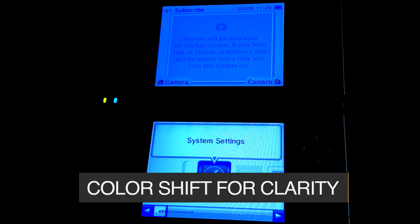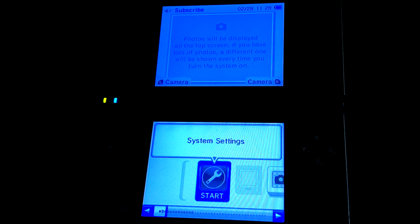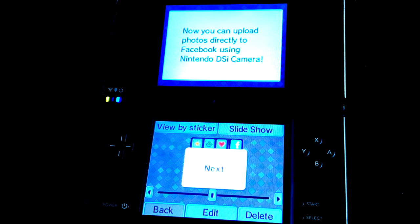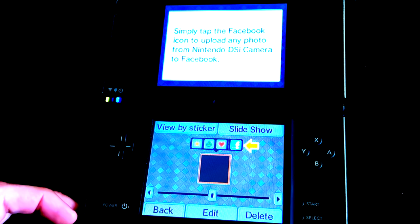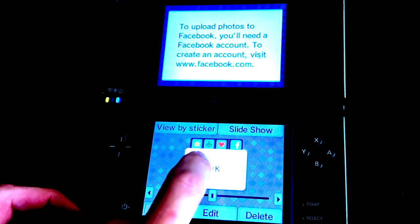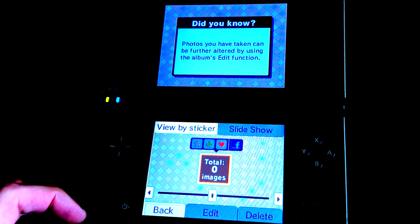The first step of the journey into custom firmware requires the use of the camera app, so let's make sure yours is working correctly. With your DSi powered on and the SD card inserted, press the left and right shoulder buttons together to activate the camera app. If you have a factory reset DSi or have never used the camera app before, you'll need to go through the initial setup process — this is an important step. If the camera app can't get through the tutorial successfully, or you have a physical camera problem, this method isn't going to work. Using the camera app ensures you have the proper folder structures in place on your SD card.